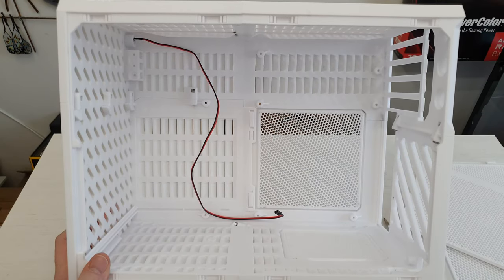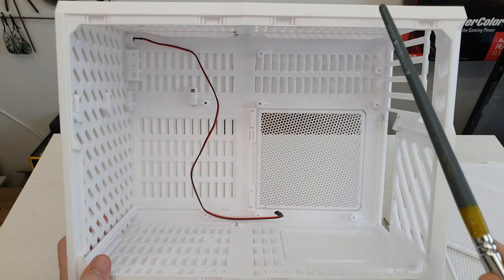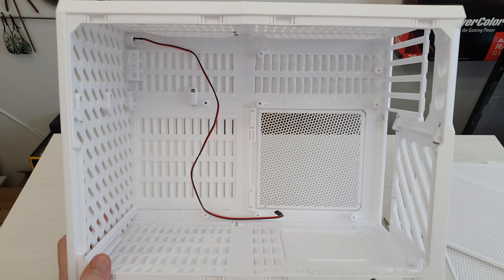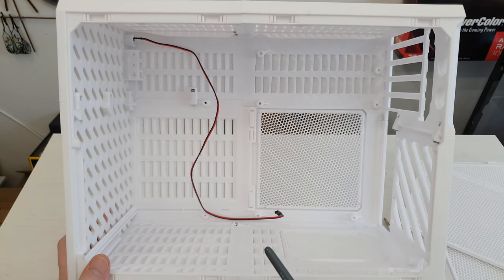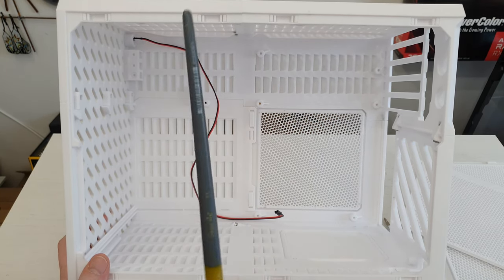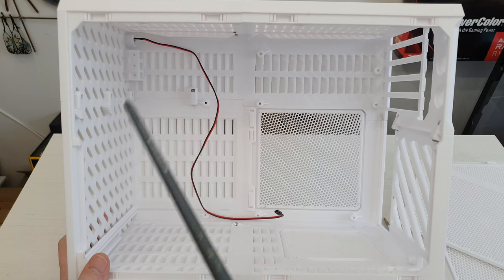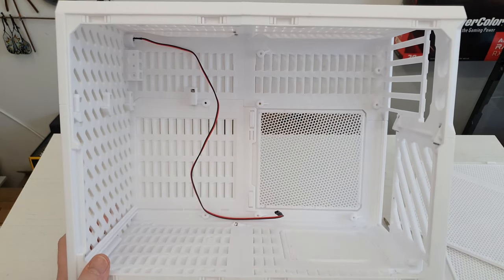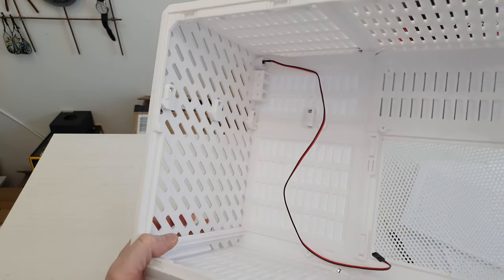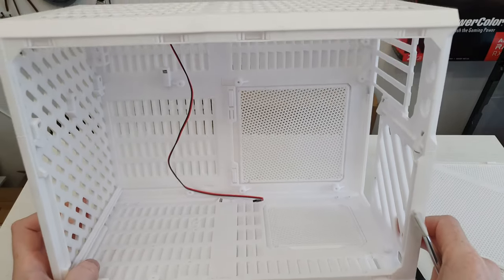The first thing I need to mention is that this chassis consists of four different corners. All four corners are printed separately, and that's because standard printers such as my Prusa MK4 are not big enough to print an entire half. If you're printing the Mini ITX version then it will be only two parts, each printed separately. Once we have four corners we need to connect them with these kinds of connectors using M3 screws — quite a few of them: three on this side, one here, and then a couple there and a couple there.